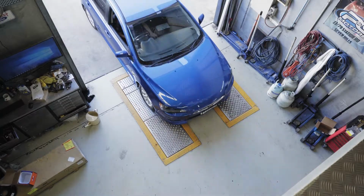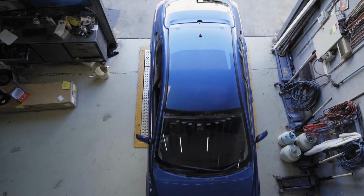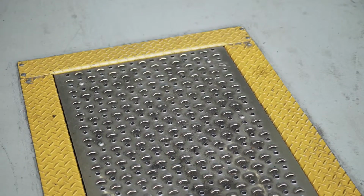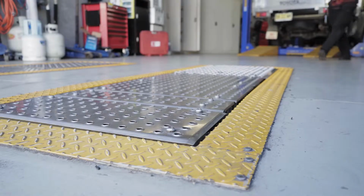When tradesmen have too much weight on the back of the vehicle, it gives us a clue of what their weight distribution's like on the rear axles to know whether we need to upgrade their springs. How far are they over the GVM, or is the vehicle overloaded and that's why the brakes don't pass? The SafeTstop's got a good feature of being able to tell weight per axle. Even though it's not a certified weighbridge, it still gives us the diagnostic aid to know what's going on with the car other than guessing.